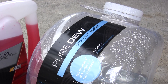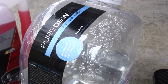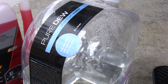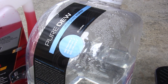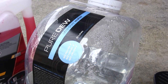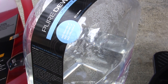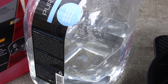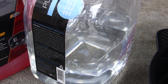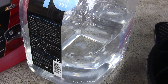You should use pure water or distilled water as opposed to tap water when you fill or flush your radiator, because mineral water is bad — it can have things start growing in there. You want the water to be as pure as possible. You'll need roughly 5 litres of water per flush, so multiply that by however many flushes you intend to do, and then about 4 litres at the end for the final top up.